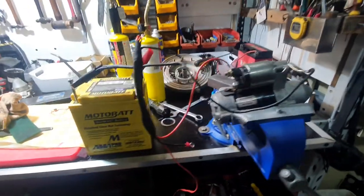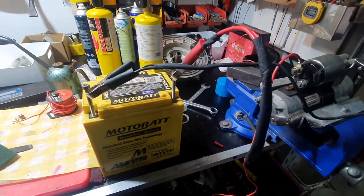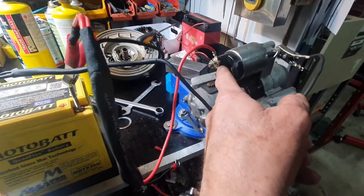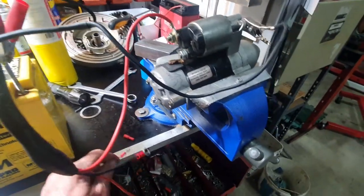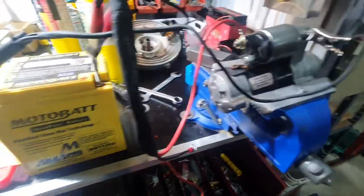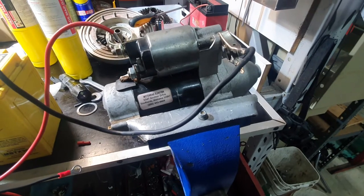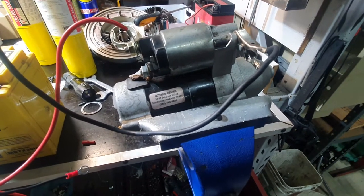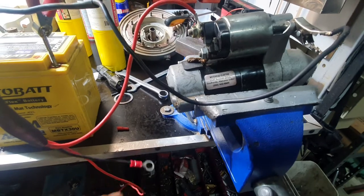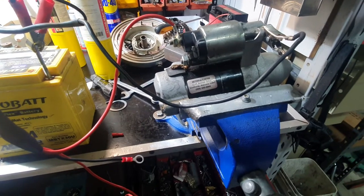This is just the rig that we use here. It looks a bit up in the air but it's not really — it's just a couple of battery terminal clamps. There are two red wires coming out of there. One is a fairly heavy wire that goes straight onto the solenoid, which is where your battery connects out of your bike. The other one has a little plug that I keep covered so I don't accidentally touch anything. The heavier black wire we just earth out on the starter motor body, because the starter motor earths against the alloy of the engine in the bike, which is of course earthed back through the frame to the battery. There is another extra black earth wire in case we need one — if we can't pick up an earth the way it should work, we can try some other things.